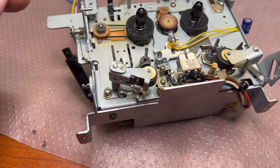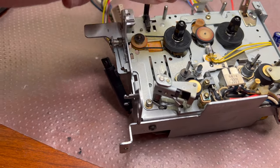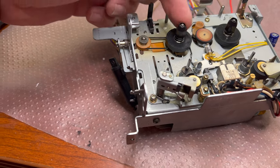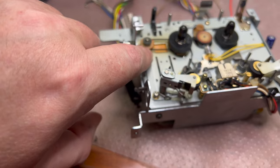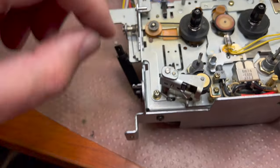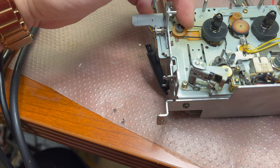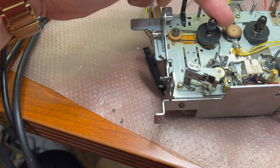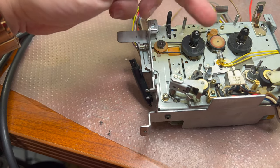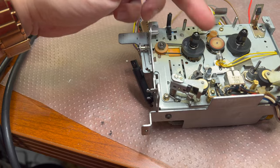Comparing to Nakamichi, the regular pinch roller is installed here. The left roller is different on Nakamichi — there's a lever which engages into the tooth of the corresponding part, and when you engage play mode it stops one part. Here it's just friction, so I don't feel too much — maybe four or five grams maximum friction on the supply side, versus the ten grams on Nakamichi.